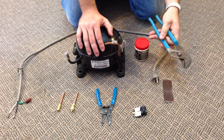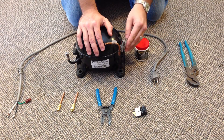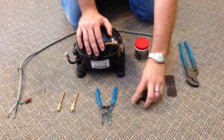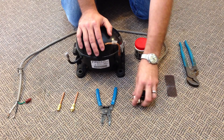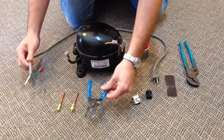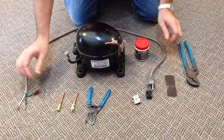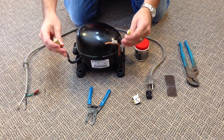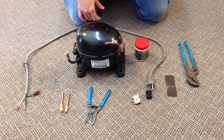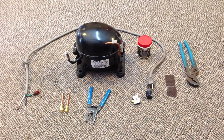A few things you're going to need: a pair of channel locks, which are going to be used for crimping the copper once we put our valves in. You're going to need some sandpaper — if you got an old compressor, the connectors or tubing may be dirty and you'll have to sand that down so the solder will stick. You're going to need an old relay off a working compressor, or a good relay you know is good, to actually power the unit. Wire strippers, because you're going to need to put quarter-inch ends on an old cord to hook up to the compressor. You'll need two valves, solder — 15% silver — some flux, and finally a torch.